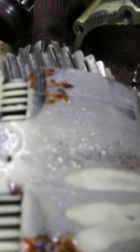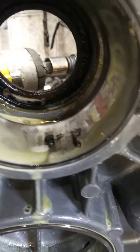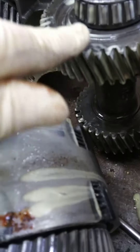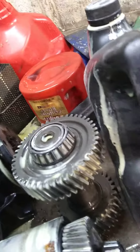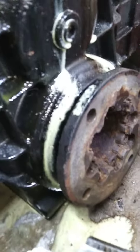What we have is rust and water in the transmission. The bearings and races are all pitted. We have chunks on the intermediate gear and the outboard gear. It's going to be fun getting this apart — this might actually have to go to the machine shop.